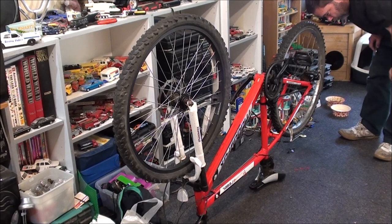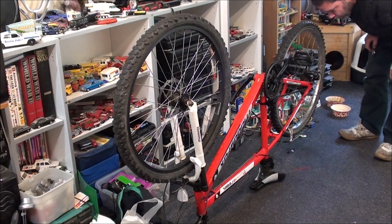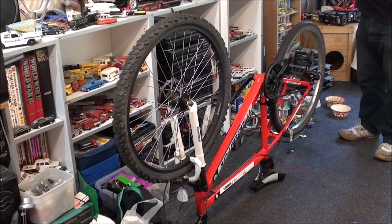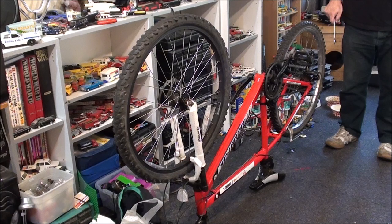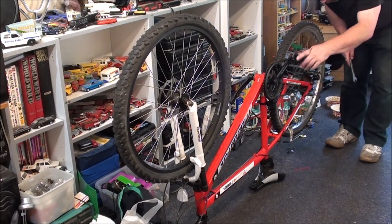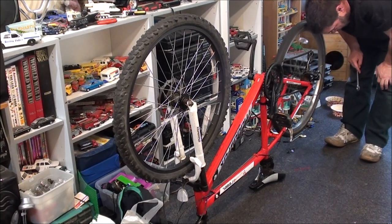Start to make sure we're still roughly in the centre. There's a very slight buckling in that wheel. I've just seen another problem as well which I can't address while I'm here. I might actually see if I've got another wheel over at Mum's — I'm going over to hers tomorrow. This one has got a buckle in it. I have got my spoke key here, so I could potentially just straighten this one out.